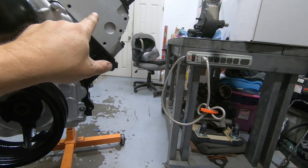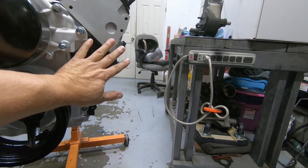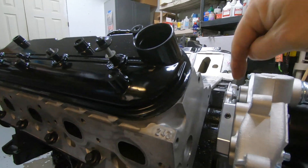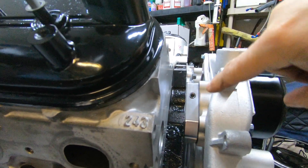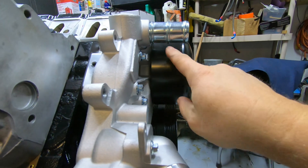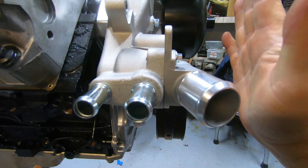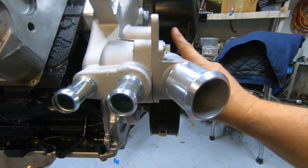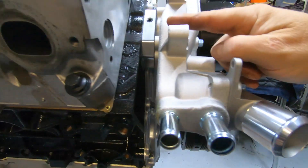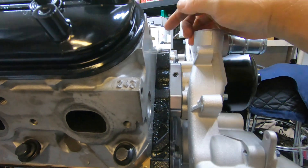More importantly, it's also going to upset the other accessories you're going to attach to the front. When we put the power steering pump and the alternator on, if this thing is set back, all that stuff is going to be set back too far as well. So to start off, we're going to have to space this thing out. Luckily they make spacers for that scenario. This spacer takes this pump and offsets it just that little bit, and this helps the alignment between the water pump and the balancer.